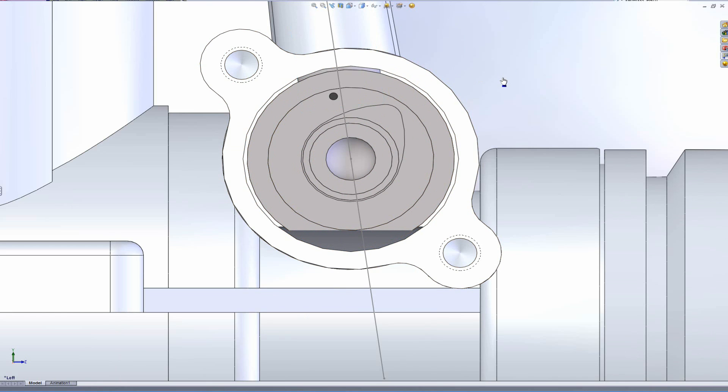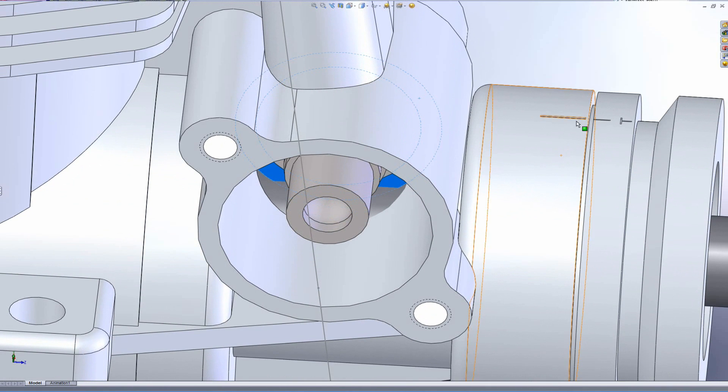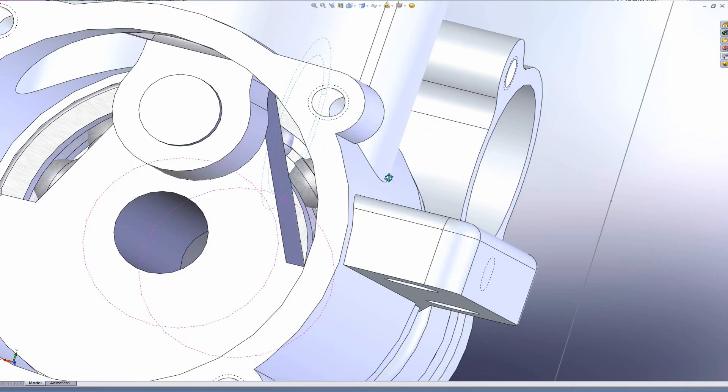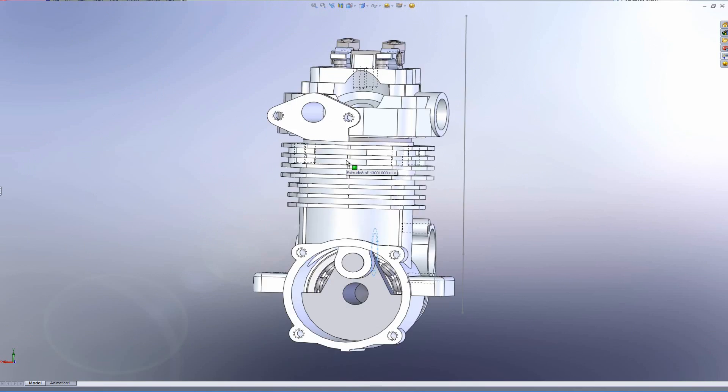If you're reassembling an engine, you would do that before you put the parts in and you could see it at the top as well. Align either the prop driver marks or look at the crankcase or crankshaft to verify that it is at top dead center when you're aligning the camshaft.